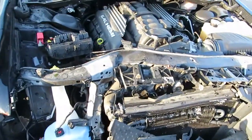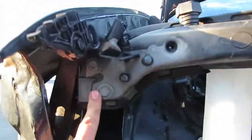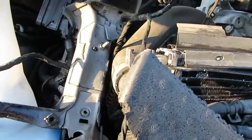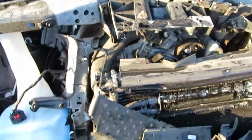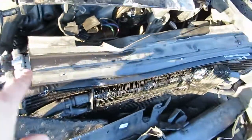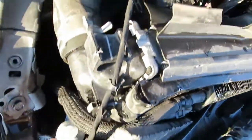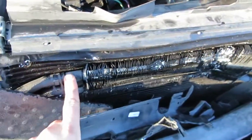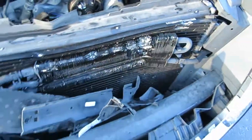It's very light damage. You need an upper radiator support tie bar — as you can see, it's a bolt-in. It'll bolt down here, bolt over there, it's all bolted together — very nice and easy. The radiator looks straight up here, but odds are it's probably shot. Obviously the condenser is shot. I'm assuming this here is your power steering cooler, and maybe a transmission cooler that's bent as well.